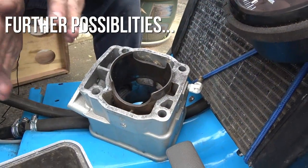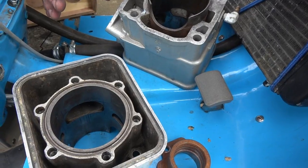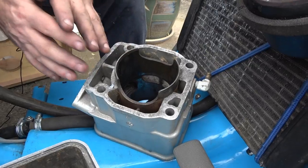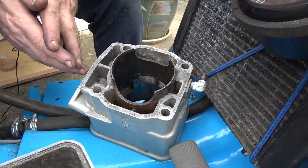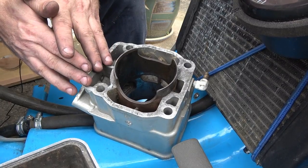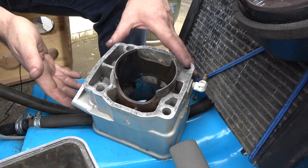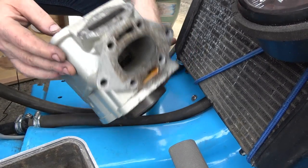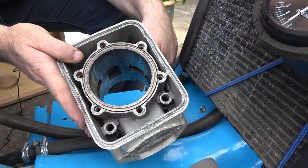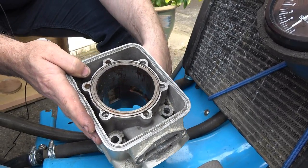This is the bigger brother. The program was to test the smaller 580/587 cylinders first, and then the next cylinder up in the family is the 787. So this is half of a 787 Rotax jet ski engine — typically 150 brake horsepower as a twin. It is power-valved, with an 82mm bore and a 74mm stroke.